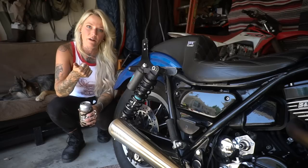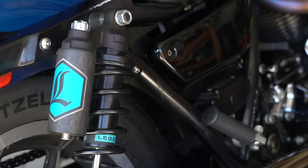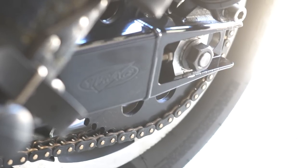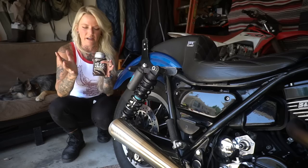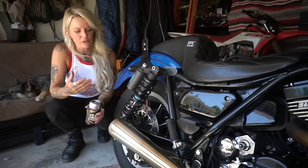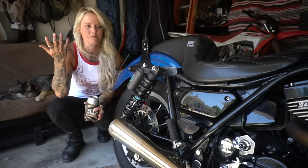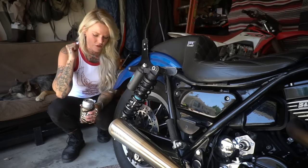One thing I really love about the Legend suspension is everything is adjustable by hand — no tools required. Your rebound, preload, and compression can all be tweaked according to rider size, whether you're adding bags or whatever — no tools involved. The swing arm, as you can see, is much beefier than the stock one. This really got rid of the weird wobbles and that torsional flex you get from the stock swing arm. Combined with the stiffness of this front and rear suspension, all those speed wobbles, the diving, the dipping — that just comes with the territory — has been gone. I am so thankful for that.